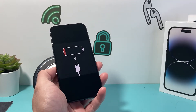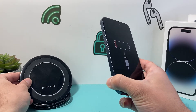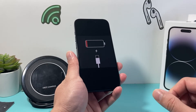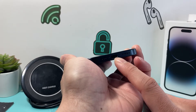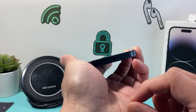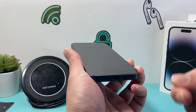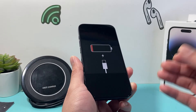You can also try to charge it with a wireless charger, because newer iPhones have wireless charging. It might help if the charge port is broken and not charging correctly — a wireless charger will also charge up your phone. Also make sure there's no dust, debris, or lint stuck in the charge port. You can clean it out using something small, or use a flashlight to check for dust buildup that could be preventing the connection.